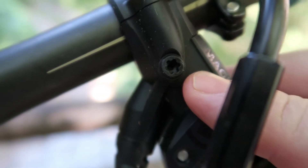All I know is they're the best set of brakes I've ever used and I have no complaints on the feel whatsoever. The one thing that perhaps is an issue with having a plastic bracket and reservoir is that you can't put a metal screw into a plastic body — the screw always needs to be the weak link, so it should fail before the body. Because the bracket is plastic, the screw also has to be plastic, which means you have to be really careful not to over-torque things. It'll seal well because it's plastic, but that's something to be aware of.